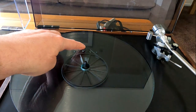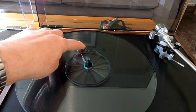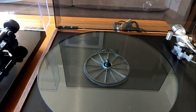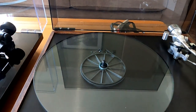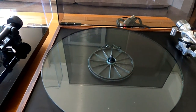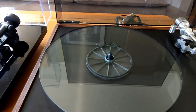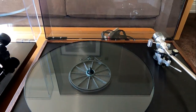On the original you can see the phenolic resin pulley. These are still on the 240-volt motor, which continued right through till about 2000 - the mains motor. That's the Premotec motor. A guy in comments said the problem with Regas is they used that rubbish Premotec motor, which is the same motor that Linn used in the Sondek, Pink Triangle used in the Export and the PT2 and all those sort of decks. Loads of people have used it because they never fail - it's absolutely indestructible, the Premotec motor.